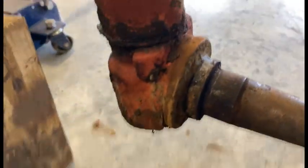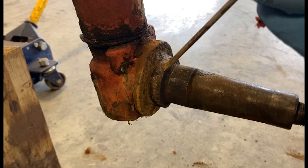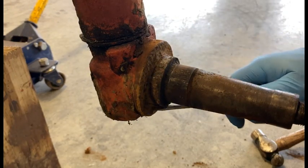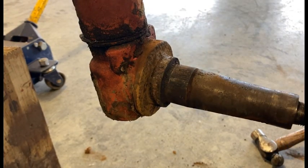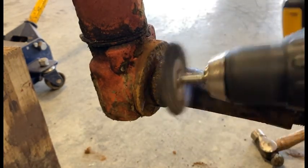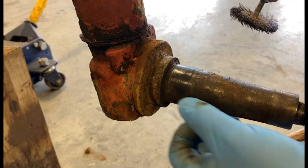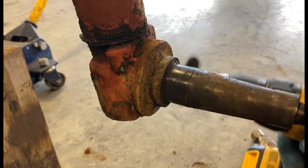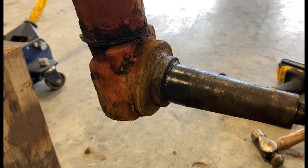As I mentioned, there were some rusted pieces on there so I'm simply knocking that stuff out. I don't want anything to mess with my dust shield once I get it put on here, which is the first part that I will install. Now you can see the difference in the machining — a nice flat surface with a little shoulder there where it gets smaller and tapers — that shoulder is where your bearing will start driving on. We got that cleaned up.